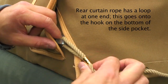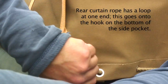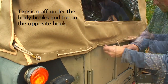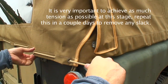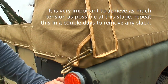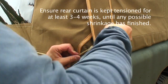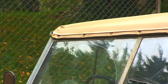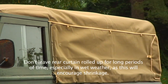Once you've done everything and checked all the tension of the straps, thread the rear of the canvas onto the tailgate as tight as you can. You will find there are still quite a lot of creases — the canvas is quite generous — but over a week or two, especially with some rain and bright sunshine, it will shrink and settle down, pulling itself tight over the hood sticks. Ours has been on for about a month and it's a great fit. You'll be amazed at the difference a nice canvas makes — it reduces wind noise and it's just such an improvement.